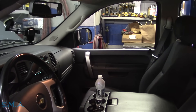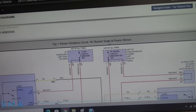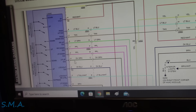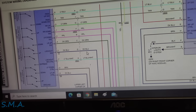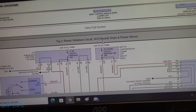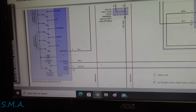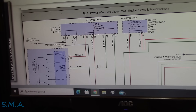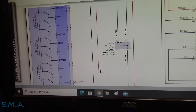But if we go over there it works just fine. So typically I would just grab a wiring diagram. I see there's a couple different ones - it says power window circuit with bucket seats and power mirrors. Then it shows the switch, which surprised me - I can't believe this doesn't work on a low speed data network. This is old style mechanical switches. And then we get to the diagram power window circuit without bucket seats and power mirrors. In that one there's no wires on the switch - we've got a power, a ground, and low speed serial data, which I would expect this to work on. So fast way to find out is just pull that switch out and see how many wires we have going to it, and that's going to determine how we're going to test it.